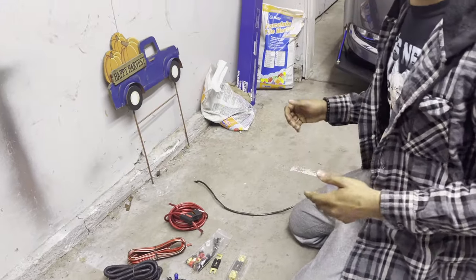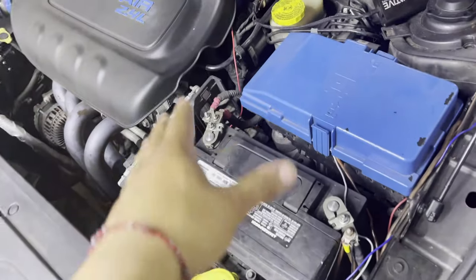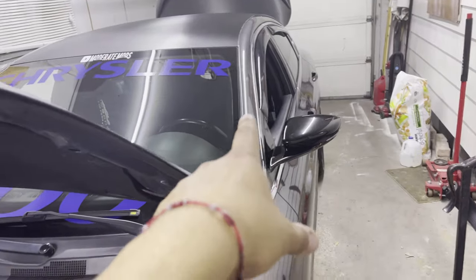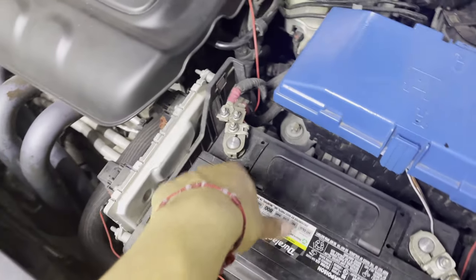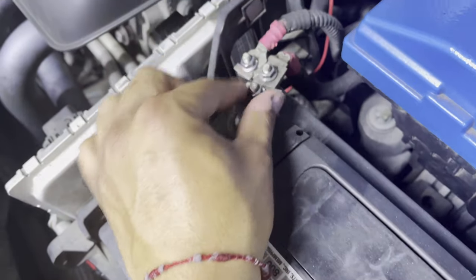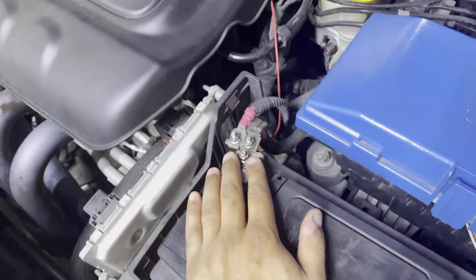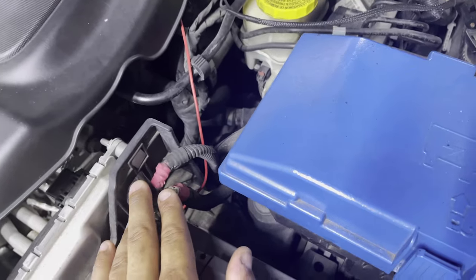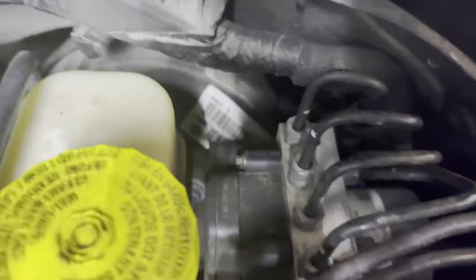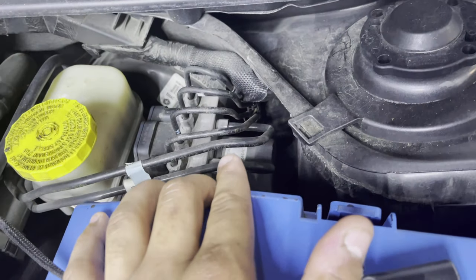When you come up to the engine bay, you've got your battery. In any car you're going to have a positive and a negative. Sometimes in a Cadillac or similar it'll be in the back seat, which is honestly even better for subs in the trunk. In our case with the 200 the battery is right here. The red wire goes to the positive terminal. I'm going to use a boot and connect under this bolt. We're going to run through the firewall, following the wires going into the car. We'll go through down in there and show you step by step how to access that.